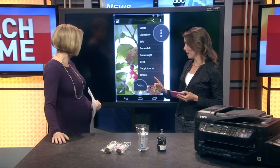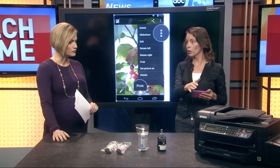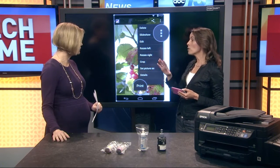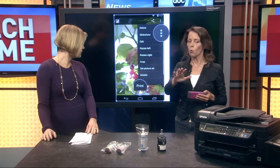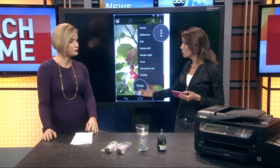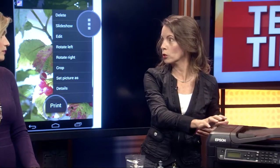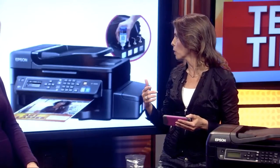Now if you're on an Android device, it's a little bit different. Android didn't support direct wireless printing until KitKat 4.4. The way you can check to see if your device supports it is go into the menu option and see if you get a print option while you're on the same wireless network as your printer. If you don't see print, then you can go to the Google Play Store and see if they have an app that will support your printer. It's a little trickier with Google, but the newer ones support it pretty well.